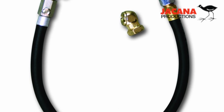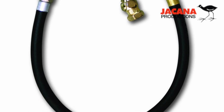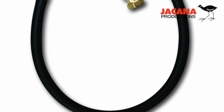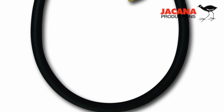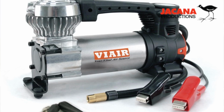Having said that, the caveats are you don't want to let too much air out, because your tire may be so underinflated that once you get out of the snowbank, it might be dangerous to drive at any speed when you have to go to a gas station. So you also might want to have one of these little guys, and I don't have one of these, so don't feel bad. This is a little portable 12-volt compressor. You can get it for $20 on Amazon, and I hear this is a $60 one, I think. So you'd lower your tire pressure to what is needed to get out of the snowbank, and once you've got out, you'd park somewhere safely, attach this to the battery terminals, and pump up your tires.